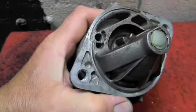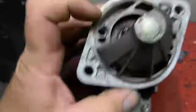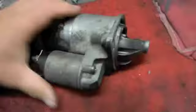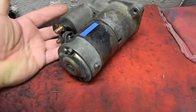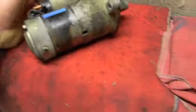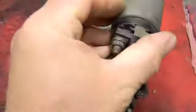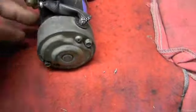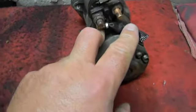Then I put the two long bolts in, which actually come out the other end — right down here and right down in there. The starter is not sanded and painted black and shiny looking, but the inside is spotless. I'll make sure it's clean, because that's where it gets its ground. On a Mitsubishi, they run the ground wire on the other side of the bolt by the transmission. There's a new positive brush installed.